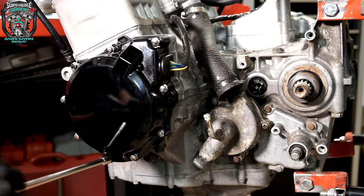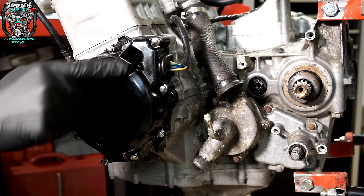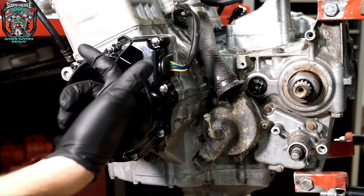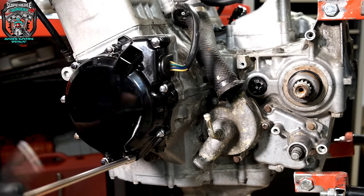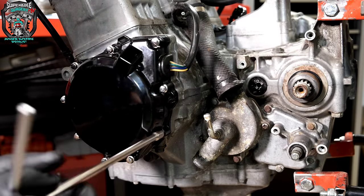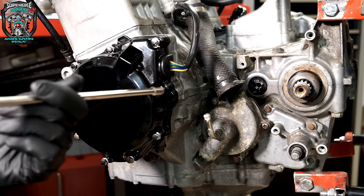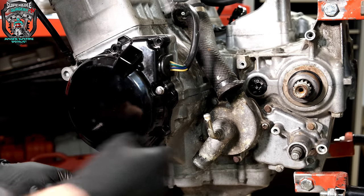One of the giveaways is that the coils are bolted to the inside of this cover. Can you see this little raised piece? Wires go in there — there's a little clamp on the inside holding the wires to the inside of the cover. That's a giveaway that the coils are bolted to the cover, not to the crankcase. This might be quite hard to pull off because you're pulling against magnets as well. You break the gasket, tap with a hammer, and then pull.